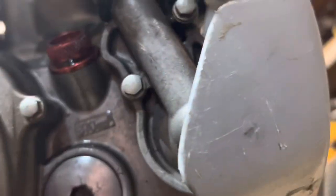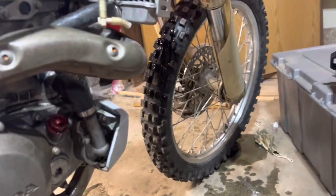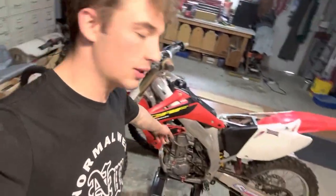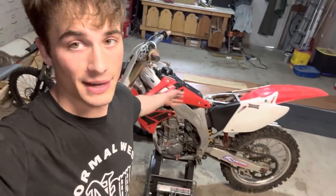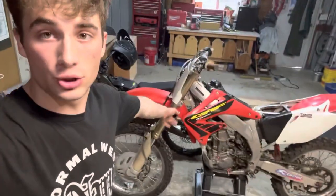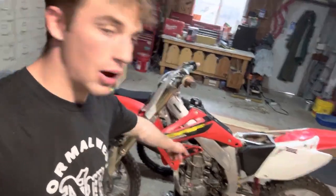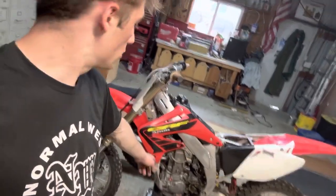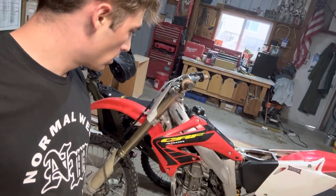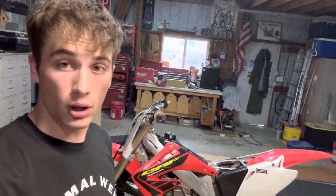Well, it looks like it's leaking a lot of freaking oil out of the exhaust. So, yeah, that's not good. So off camera, I fixed the oil leak. I just messed up on the top gasket. It was crimped a little bit and leaking oil. And so everything should be ready to go. The cam gear is now aligned. The chain is tensioned for the timing chain. Yeah, let's give her a quick start, see if she works.